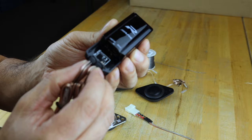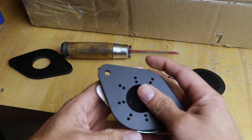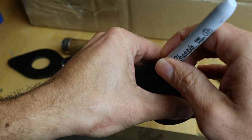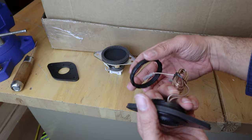We can't just drop the tweeters in the car without securing them somehow. You can get speaker adapters that allow you to mount the tweeters in the proper factory location. These are specific to the WRX and STI and they come with pre-cut holes. I had bought these before I settled on the speaker kit so the holes were far too small for the Alpine tweeters. Thankfully I can easily cut them to size by measuring the tweeters and using a handsaw. You can avoid this by simply measuring the tweeter ahead of time and ordering the proper adapter.